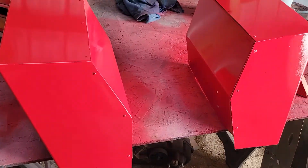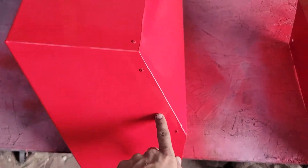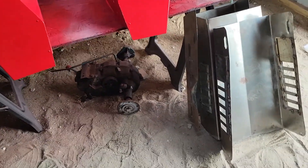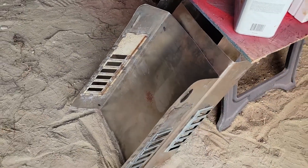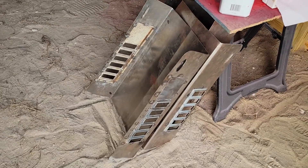The fenders for the Roper are right here. They turned out pretty good. Since they were made, they have all these rivets on there. You can't really weld that stuff other than a little tack weld because you'll just burn through it — it's so thin. I made these hoods yesterday, so the next thing to do is clear this red stuff out of here and then paint these eventually.